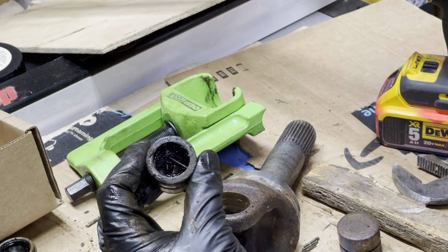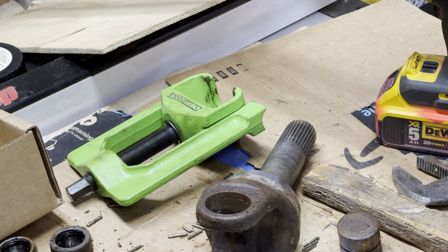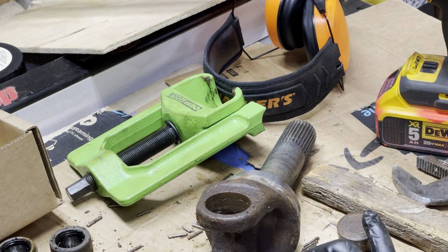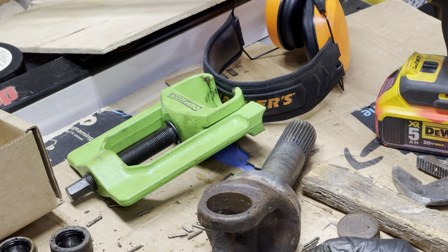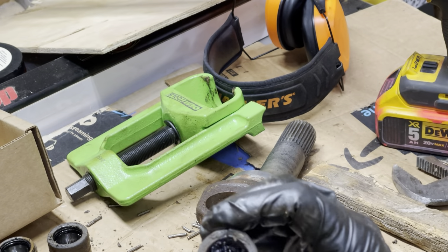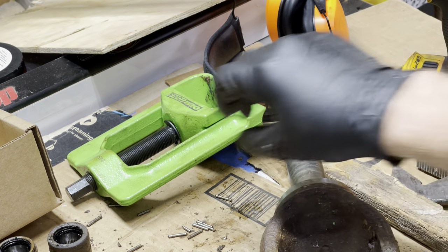That was missing about half of the needles and I didn't see them fall out. Something else I found with the last one of these I put together: if you take an angle grinder and just touch these edges where those c-clips clip in and retain the cups, just touching these surfaces it'll go back together a whole lot more smoothly and not bind up. Just get rid of the rust and take off just the tiniest bit of metal — that's all there is to it.